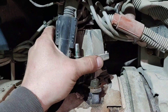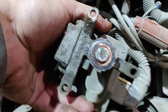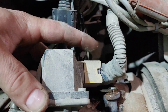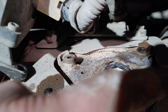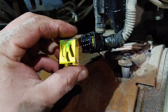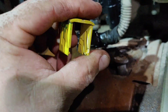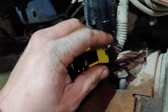The three bolts are out. So it says this is overdosing. I'm going to take this plug off — I usually take a flat blade and carefully work this yellow piece outward, that slides out, and then you can pull the plug off. I'm also going to clean that out in there. These break very easily — every time I change an after treatment harness, I save these. There are little tabs in there, one on each side; push those in and you can pop this out and replace it. I've got a whole drawer full of these because they break very easily.